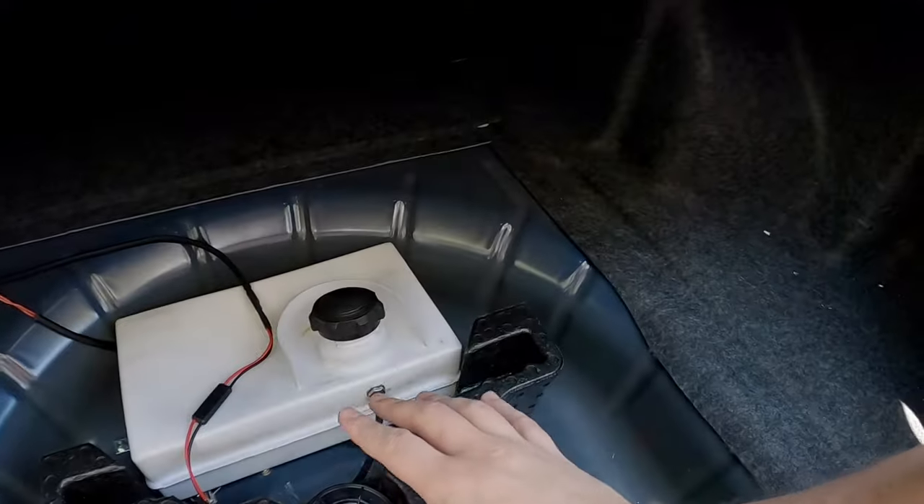That means I need to address the venting of this tank. Fixing the cap is not a big deal — literally just put some silicone in that top hole to plug it up and turn my vented cap into a non-vented cap. Properly venting the fuel cell itself is a little bit more complicated and more involved, but it should still hopefully be mostly straightforward.